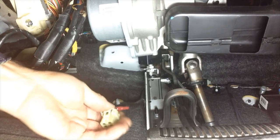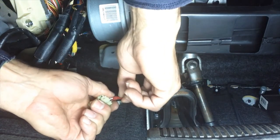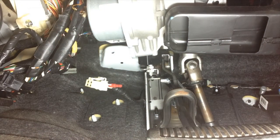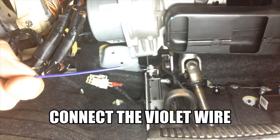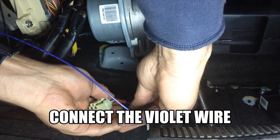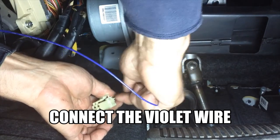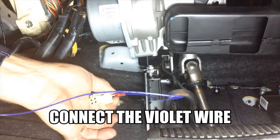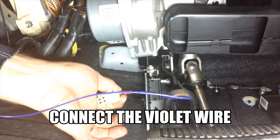If the wire smushes, it's too tight. To put our incoming wire into the tap, loosen the collar about a turn and a half. Strip about an eighth to a quarter inch off the incoming wire, put the stripped wire into the collar, push it in until it bottoms out and goes in all the way. Hold it in and tighten the collar. Give it a pull test — if it comes right out, it didn't bite right and you didn't make a good connection. Go ahead and plug the switch back in.